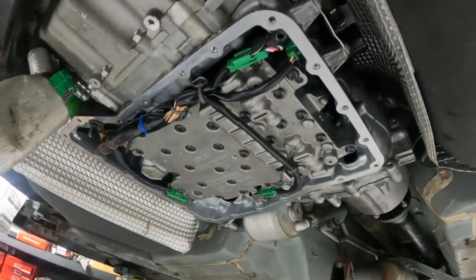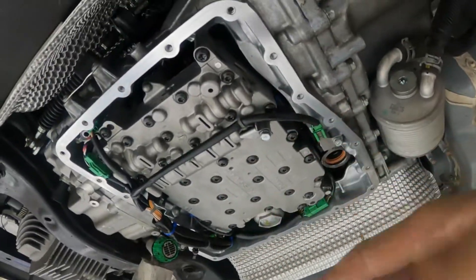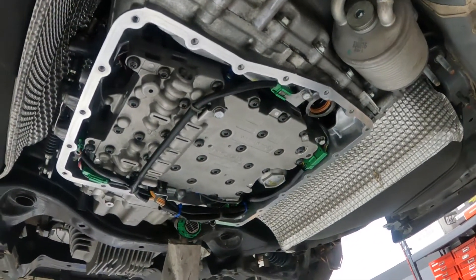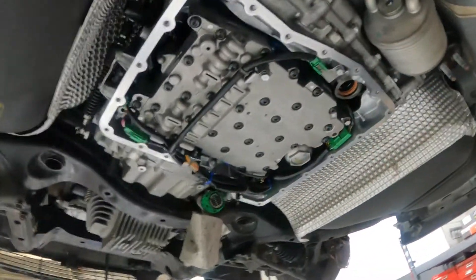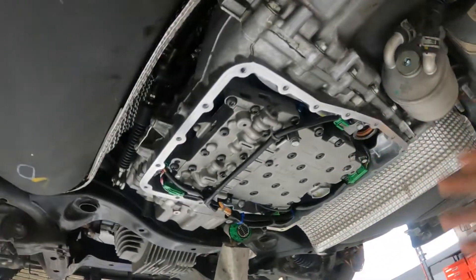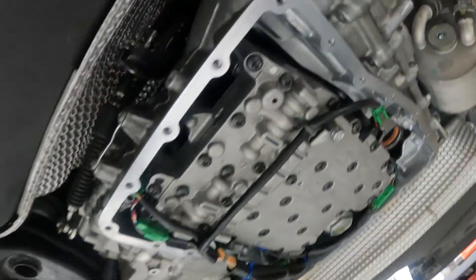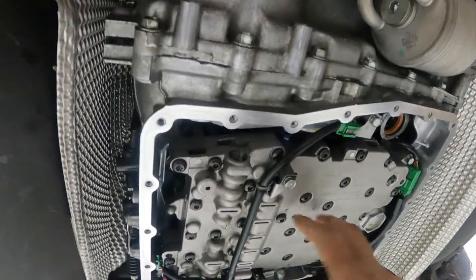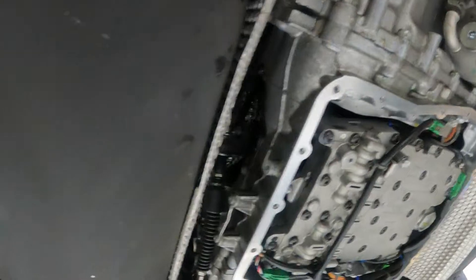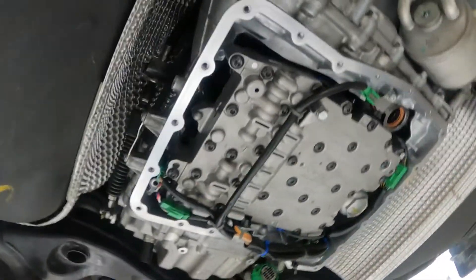The valve body is back in. For shift piston number two, I had to take a little bit of emery cloth and smooth out the actual housing. Luckily, the customer supplied a spare valve body, so I was able to get a replacement shift piston since the original was damaged. Being mindful of the magnet position is critical — if it's set up wrong it won't shift properly, or it might try to shift two gears at the same time. All pistons are now moving back and forth properly, and we locked them with paper clips so they don't twist on the shift forks during installation. The valve body slides right in without much pressure.